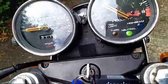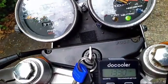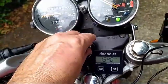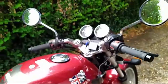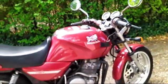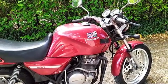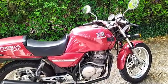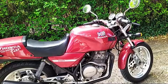See the rev counter there is playing up. Actually, it went to 1300, so I've got a little stuck. So standard was 0.19 for the exhaust. No, standard was 0.12 for the exhaust, and I've now got it switched to 0.19, which seems too noisy. So I'm going to switch it back to 0.15 and change the pilot and main jet in the carburetor next. So I'll do that in the next video.